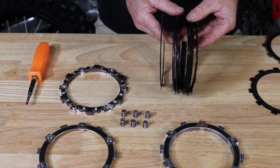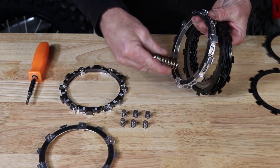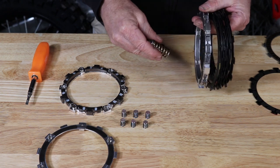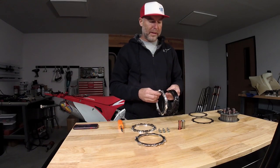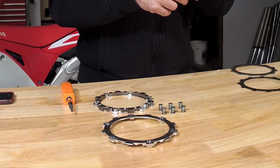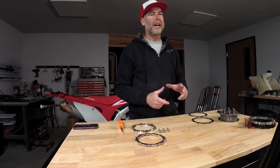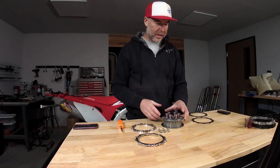When you move up to the Radius X, you get a full pack of their clutch plates matched with the EXP disc, along with a specific spring setup that works in conjunction with everything — giving you better friction with more plates working with the EXP disc. On a cable bike, the Radius X makes it feel like the cable is always tight, so you don't get the normal free play modulation. On a hydraulic clutch bike, because the hydraulic system self-regulates, you don't have that same problem.